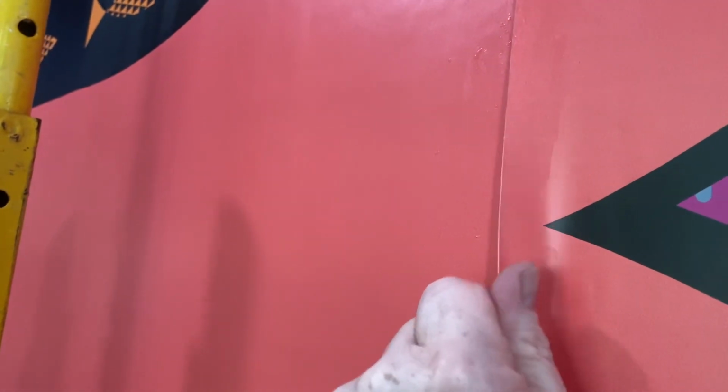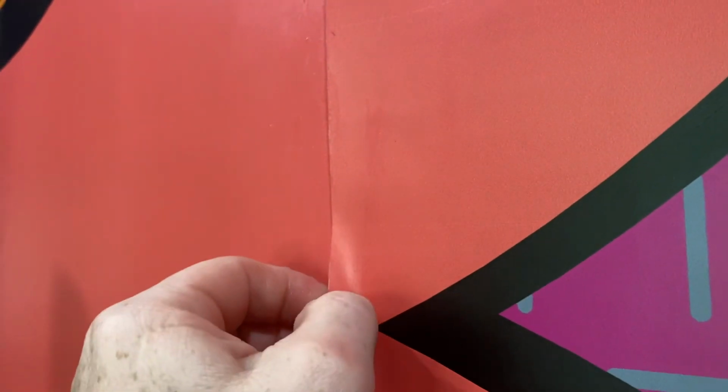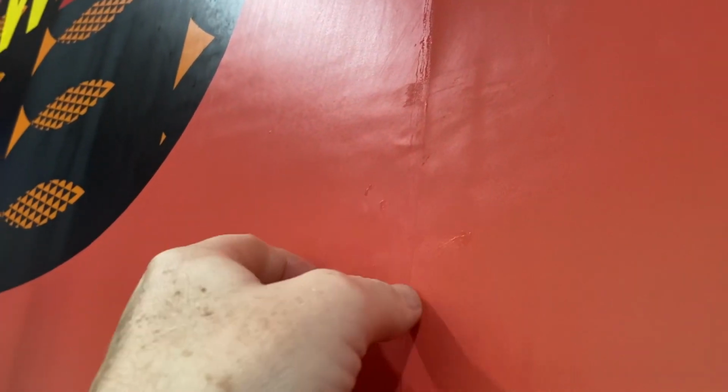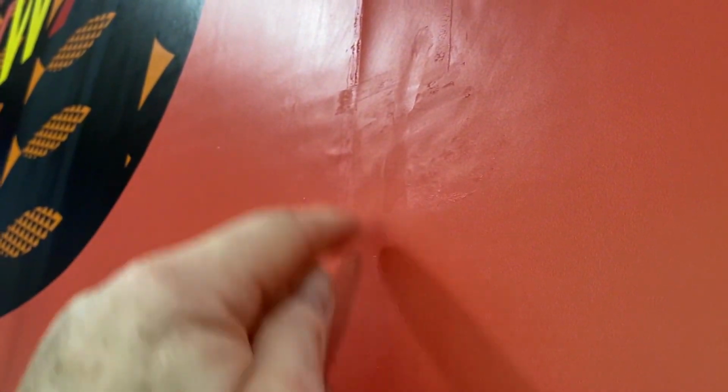Does any of you own a work truck, where they put compartments inside of the truck and the metal outside is showing? The people who look at your truck see a dent in it, but it's not a dent going in toward the truck. It's a dent from within going out. What's going on there? Well, as your truck rattles while you're driving, the metal is wrapping around this. See this little ridge here? And if you leave this too long, guess what happens? I don't want to do it, but let me just show you a little bit. You see that? This vinyl will take on the appearance of your underlap. And guess what? You're not going to get rid of that. Trust me when I tell you, I'm talking from experience.